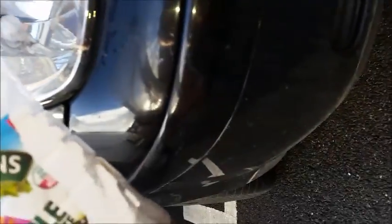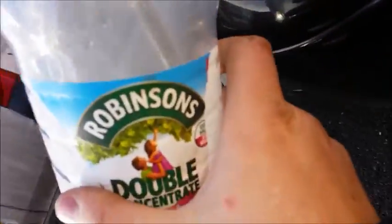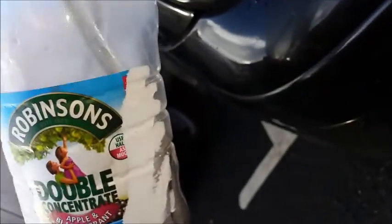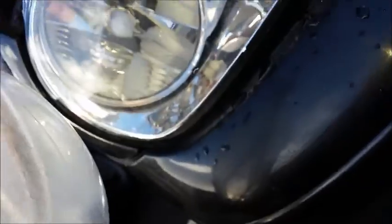I'm going to have to stop recording so I can just see for a minute. Right, so we're now almost at zero liquid. The filter is absolutely ditched. So now what we're going to do is cut the engine, pour what's left of the diesel purge into the fuel, reconnect the fuel lines.